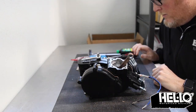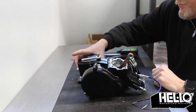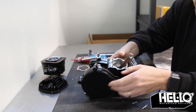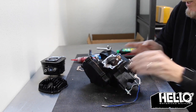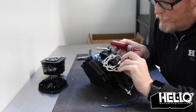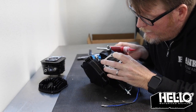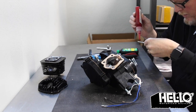So here we are with all of our parts and we're going to go ahead and start building this thing. Let's start with the bulk of the motor here. We're going to take your red Loctite and first of all we put our gasket — our cylinder gasket — on so that it lines up with the actual engine.